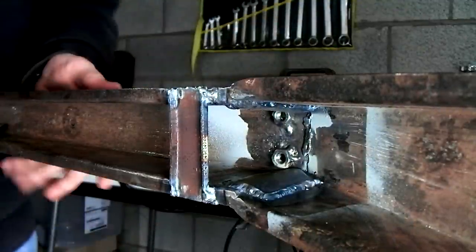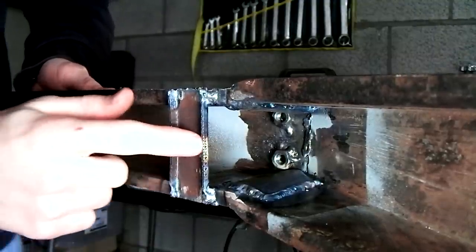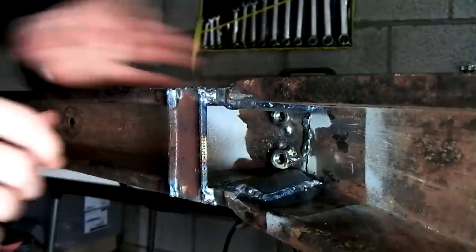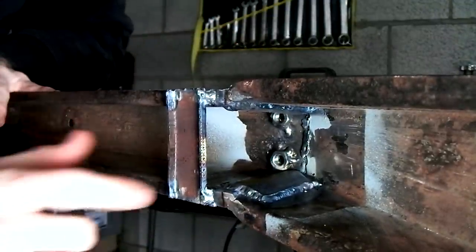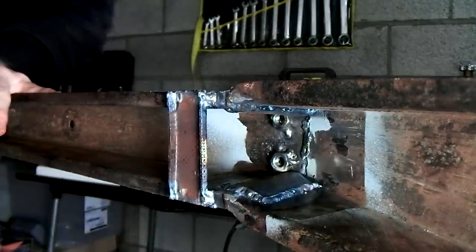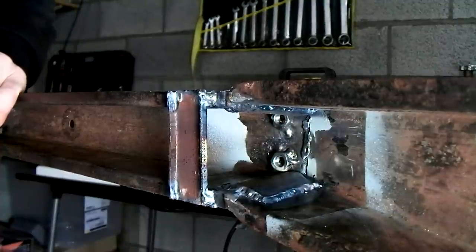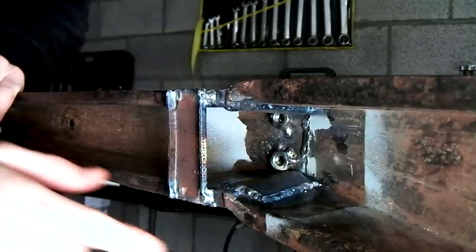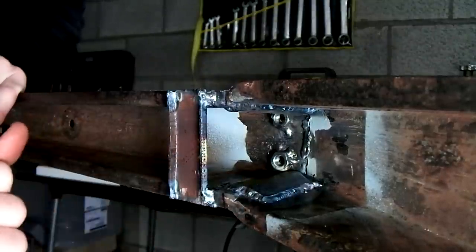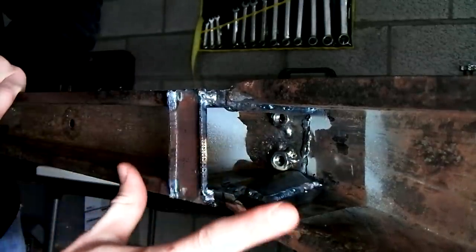This is the other side of the chassis and you can see I've welded in these plates on this side and the other side — these are the new ones that I made myself. I've also welded in the two nuts on this side of the chassis. Another modification I've made is welding in these two strengthening plates, which reinforce the joints between these two pieces of sheet metal. On the other side of the chassis these plates were already welded in — my guess is they were welded in once those cracks started to appear. So now I've welded in the same style of plates on this side of the chassis, one on the top and one on the bottom, to reinforce the inside of these joints between the two pieces of sheet metal.